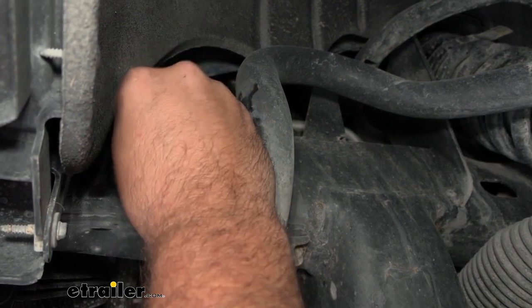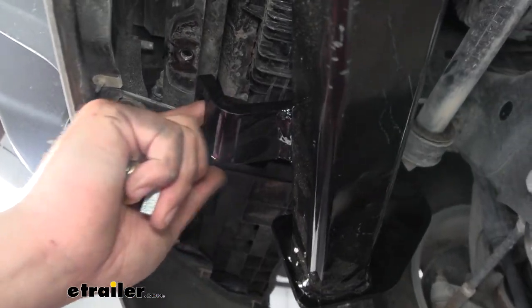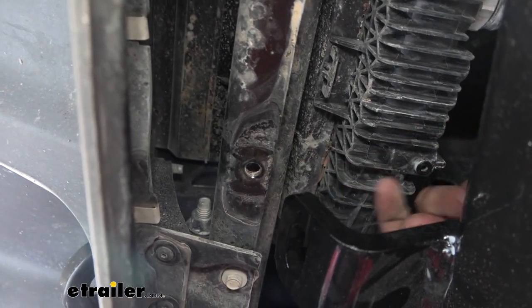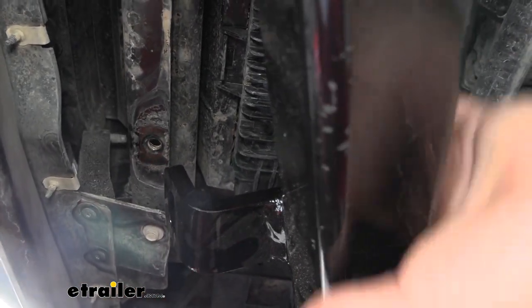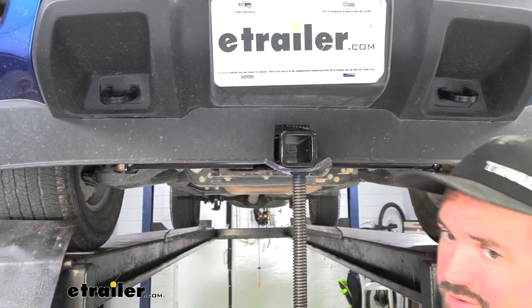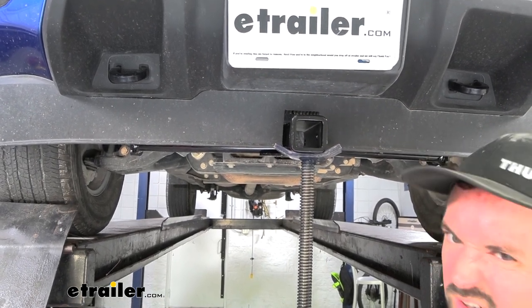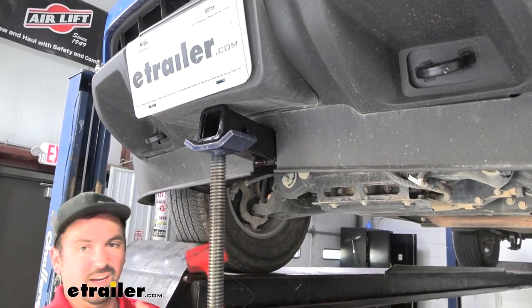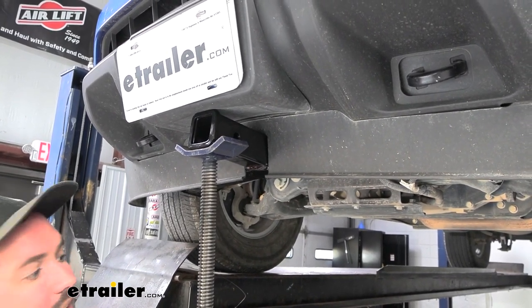Take your serrated flange nut and get a few threads started on each side so the hardware is holding the hitch up. Now we use a similar technique for the front — the hitch goes around the front portion and there are holes that align with our tabs. Feed the fish wire from the front towards the back, then get the spacer block and carriage bolt in place. Lift it up, and if you're on the floor in your garage a floor jack helps raise this into place. You may need to use a dead blow to knock it into position — once the jack is in place and you tap the back, the hitch should drop into position. Be careful as it can jolt a little. Get the jack out of the way and get your hardware in place.